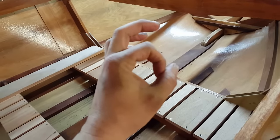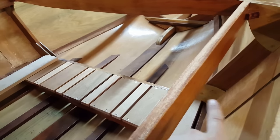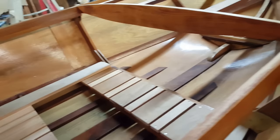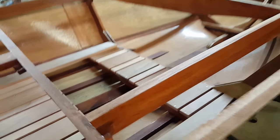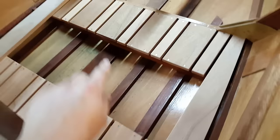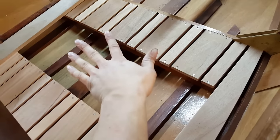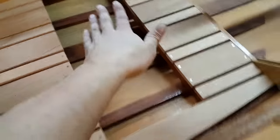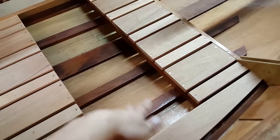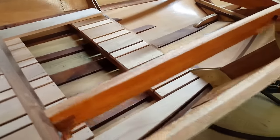I'll probably put a cup holder — one per seat on each side, same in the back. I'm also going to pick up some 12-volt receptacles, like cigarette lighter receptacles, and recess one on each side of the front so you can charge cell phones and things like that. Over here you'll see the cutout where the front seat base will sit on top. Once the seat's in, it'll look fully planked, but you'll be able to flip the seat up and this will be storage underneath — pretty cool.